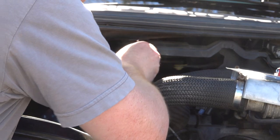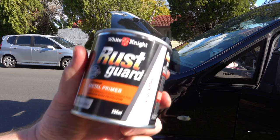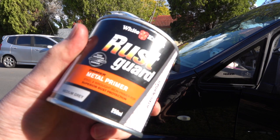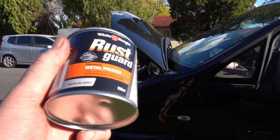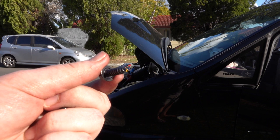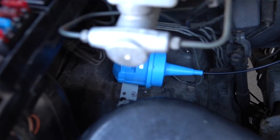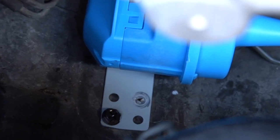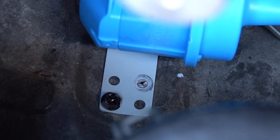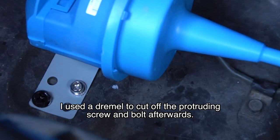Now I'm just going to cable tie everything up using these big cable ties. Anytime I'm cutting into the metal of the van I always use some rust guard — doesn't really matter which sort, this is just one I got from Bunnings. The kit comes with these little self-tapping screws, so I'm going to dip them in the rust guard before I drill them in. One went in fine but the second didn't feel like it was grabbing, so I've got a couple of M5 bolts which should do the trick.